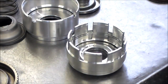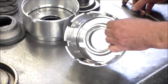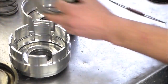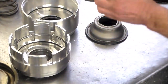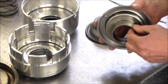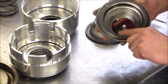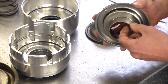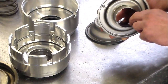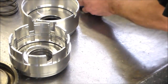This is the retainer for the balance piston and it goes in here. This is new because it comes new in the OE kits. When I take the old one out, I feel around here because a lot of times there's a step in it. This one doesn't have it because it's brand new, but that's something you want to look for. If you do feel it, I would change it — they do sell these separately. Then we have our spring and a couple of snap rings.